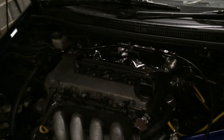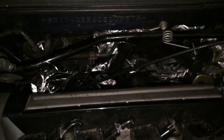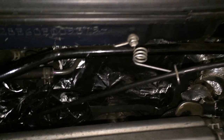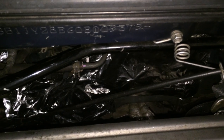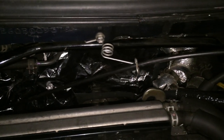So since it broke, that will be the starting point of things that I've added. I've put the reflective heat shielding on the back. That's just to protect the wiring as it does get quite hot down there. The new manifold will be bigger, so we just need to make sure the last thing I want is wires melting, as that could be a disaster.